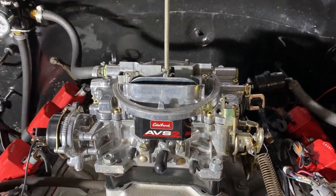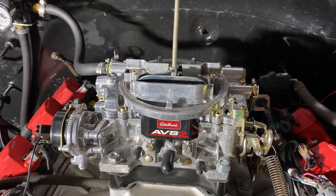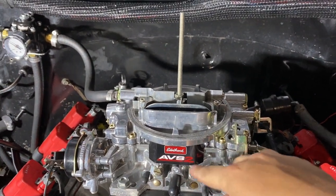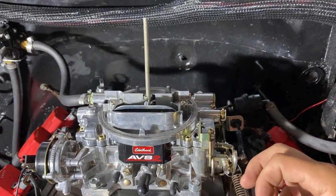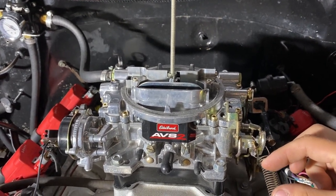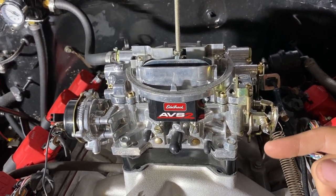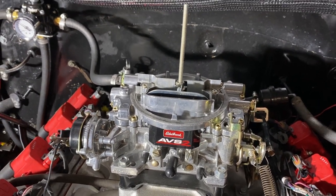They state in their book that you set your desired idle — it'll be a little rough. Then you turn the screw in and out until you exceed the maximum RPM, which should be no greater than 40 RPM at a time. What I like to do is very carefully turn it all the way in — not tight, you don't want it tight. Turn it in very slowly with a screwdriver until it stops, because you don't want to break the needle off. Then turn it out until you get the smoothest run. Luckily I have an air fuel ratio gauge so I can see what my idle air fuel is. Otherwise that is what Edelbrock calls your best lean idle mixture.